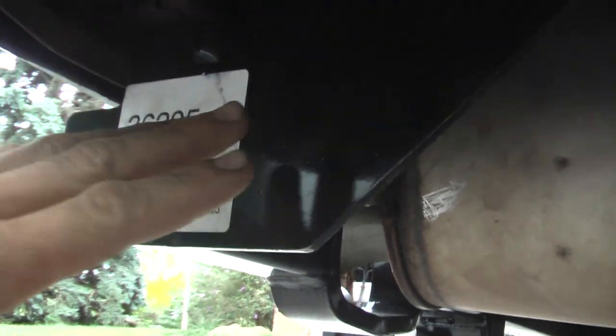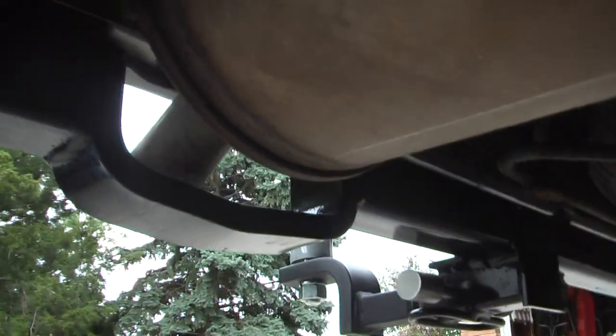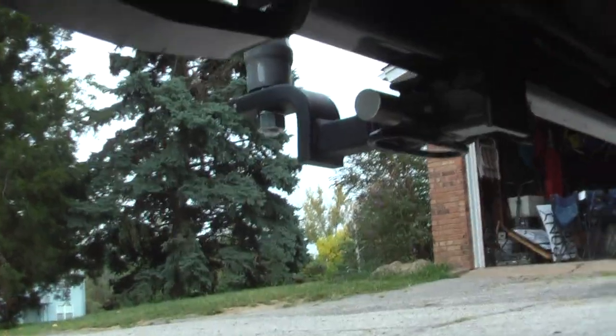As you can see here, these pieces formerly were tow hooks on the van, which were removed, and we got the new bolts up in here supporting this hitch. It's made to go around this muffler here — and before you install something like this, make sure you let that muffler cool down because that'll burn you pretty bad. This bolt back in here holds the bumper on, right in here, and on the other side it's pretty similar, except this is the one where it was so off-centered that I had to put a custom bolt and nut in there to hold this in — tightened to 60 foot-pounds of torque.